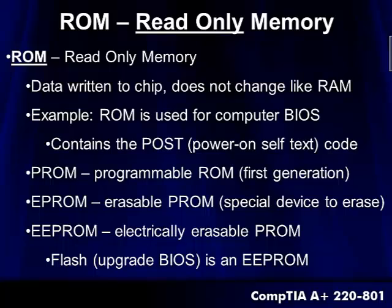Well, that's your current BIOS. And if you've ever heard of somebody saying that they upgraded their BIOS, or they might also say, I flashed my BIOS, the term flash in this case is kind of like a verb. It's what we do when we run a utility that will let us upgrade and change the version of that BIOS chip, because our read-only memory chip can be electrically erased and then completely rewritten with that permanent data on that ROM chip.